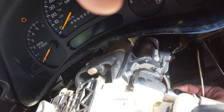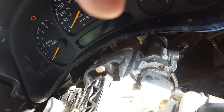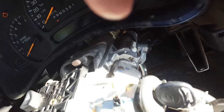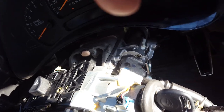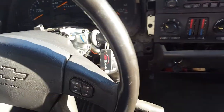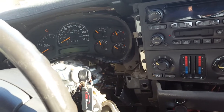A lot of people recommend replacing this part, but I recommend you check the spring first. Make sure the spring is pushed all the way back, because mine was sticking out and wasn't letting the shifter engage. I'm going to get a new spring so it doesn't pop out again. Hopefully this helps if you're having a shifter problem with your Silverado — it's a very easy fix.